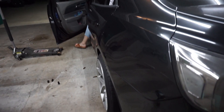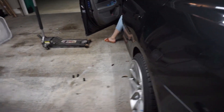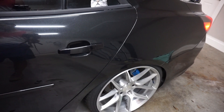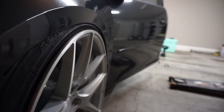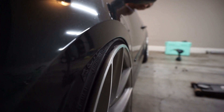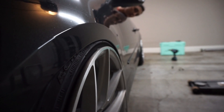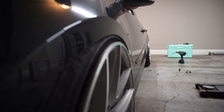We might have to switch the rear to the front like we originally had it when we bought them and got them set right with offsets. You definitely need more camber. That's why we're going to swap them. It's making that noise because it's touching the fender well now. The back wheels are zero offset though.